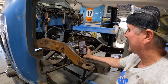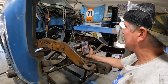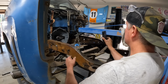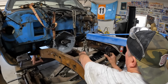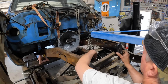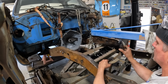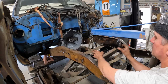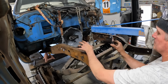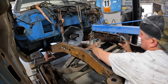It's freaking crazy. Yeah, and your axle is completely in front of the engine. I've got to deal with the crank pulley and everything like that too, because on this the crank pulley is going to want to live right where the top of that truss is. So we're going to end up cutting a bunch of that out, I'm sure, just to make room for the crank pulley and the oil pan. But I feel like if the links are farther out here, it won't be hard to get the strength back in it. It's not like I'm trying to triangulate right up in here.